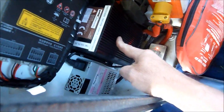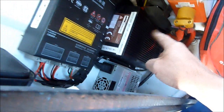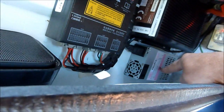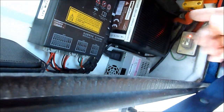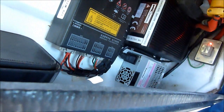This side has the DC-to-DC converter. It takes the main battery pack voltage and charges the 12-volt battery, so you never run out of power for your 12-volt system — your lights or anything driving at night. You've got as much power for your lighting as you have in your main battery pack. This is part of the battery management system: a 12-volt power supply for when it's plugged into the wall and a charging event is going on. You have to have power to control the BMS, so we have a power supply that keeps that battery charged and powers the BMS.